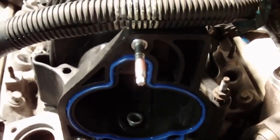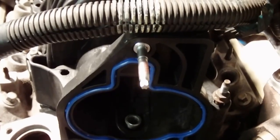And then we're going to go ahead and put the screws in. This should be 9mm screws. I'm going to put Loctite on them, but there's three in the front, three in the back. Mine had a 10 millimeter post nut screw on this end here for a bracket that supports the wire harness. And then there's another 10 millimeter on the other side, but the same thing. It's a stud with a nut. Goes in this one here. And that's got a bracket for the EGR valve, that little shield that goes around that. So you get that Loctite put on these and then get them torqued in there. You're going to tighten them up slowly by hand and then torque them down. Probably 42 inch-pounds first, halfway, and then tighten them up to the final 89 inch-pounds.